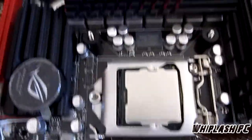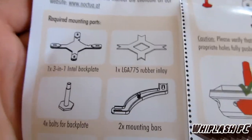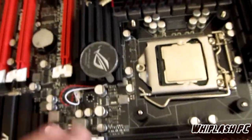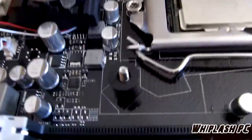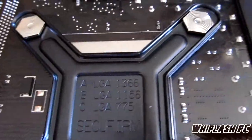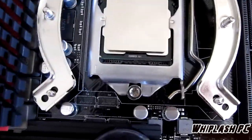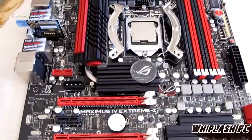Just wanted to make a video update. I got the backplate installed now, and this is the instruction manual. It's very well built. This is for the Intel instructions — they also have an AMD set of instructions. It shows you how to install it. As you can see, it's got all four prongs up and the spacers on now. It goes right around the backside and straight through the holes. It will say LGA775, 1366, and 1155. On the back you can see it goes through and around the existing backplate. This is a 2600K processor along with the Maximus Extreme Z Asus motherboard.